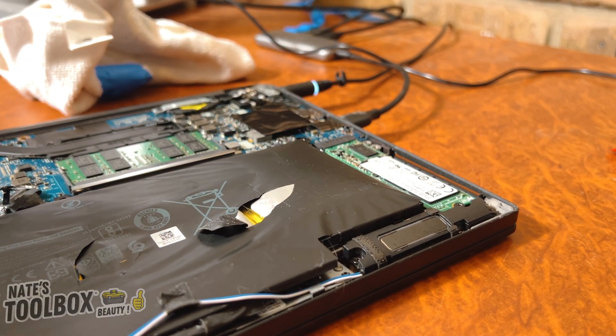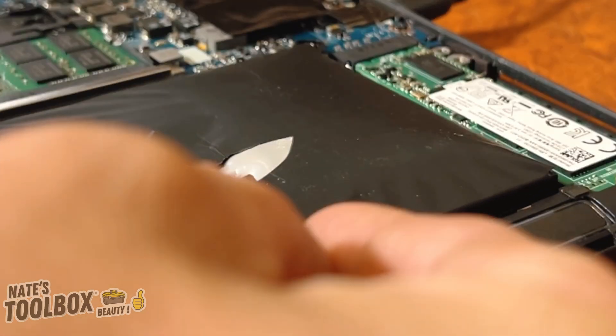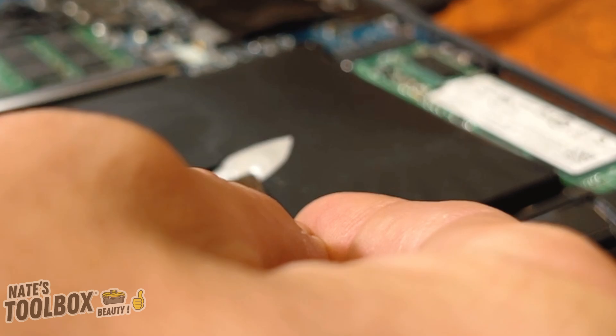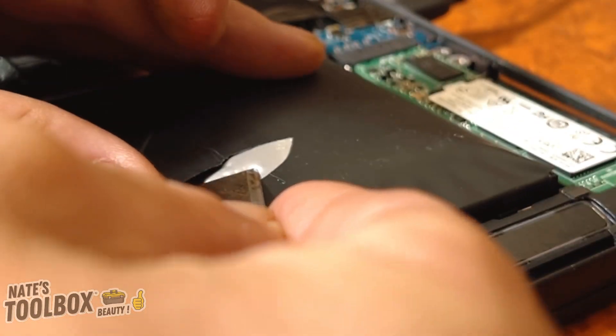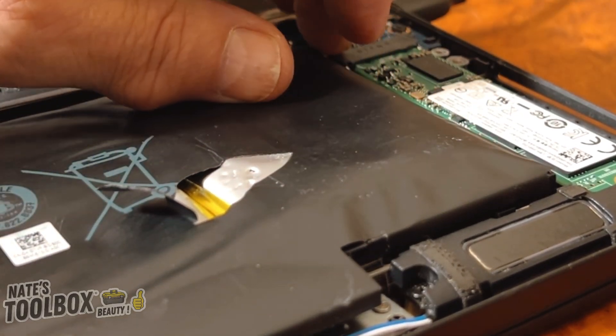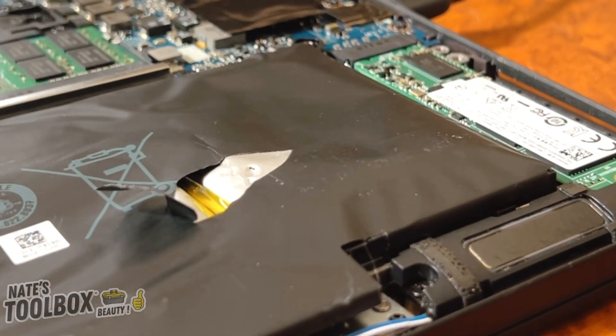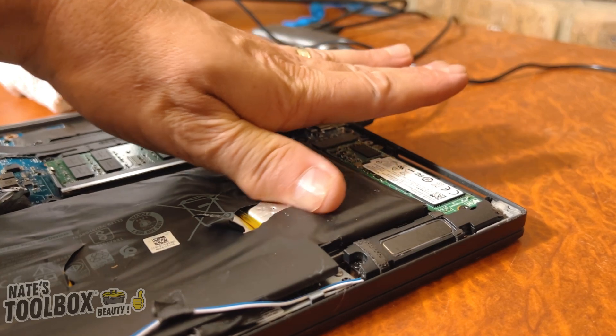That's the battery — you can see some gas in there. Get your needle and just poke the smallest hole you can in the side. I felt that go through. Don't breathe this gas in — you can't smell it or feel it, but I wouldn't get too close. I'm about two feet away. Just massage that air out of that hole.